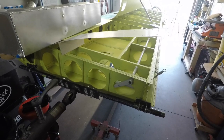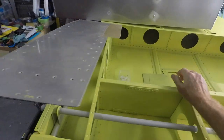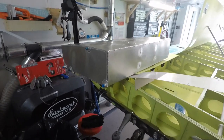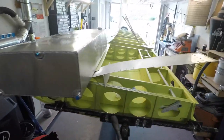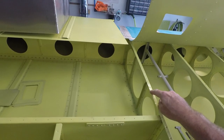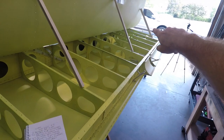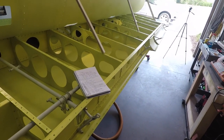Next we will install the fuel tank. This wing is flipped upside down, so the fuel tank will be dropped into this bay here, and then the fuel lines will come out from the wing root — that's where they will attach to the fuel fittings on the fuselage. Here's what the fuel tank looks like: 27.5 gallons, with both fuel bungs front and rear, and these will be the sight gauges. The fuel filler neck is located here. Once the tank is installed, we'll put nut plates in place and begin working on the tank covers. We'll run wiring out to the wing tips for lights, and we'll also have a pitot tube on this wing that will have to be installed, so we'll have static lines that will need to be run.